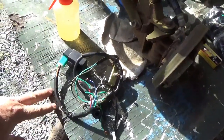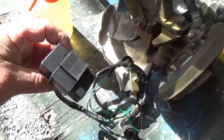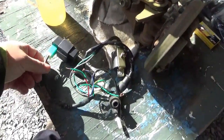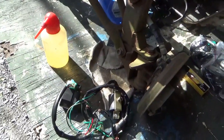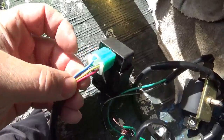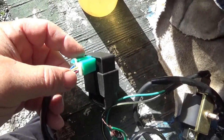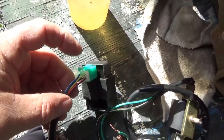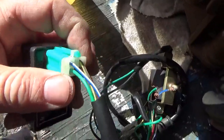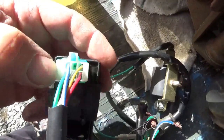So I brought this home and said, okay, maybe my ignition coil is dead — no, it was fine. Maybe my CDI is dead — no, it was fine. So I took the wires off, hooked it up, probing around and everything seems as it should be. What they did was when they manufactured it — you see the black wire with the yellow stripe and the red wire with the black stripe — they swapped these two on the harness. They were just plugged into the wrong places. So I'm showing you where they should be: that's the color code and that's the way they should be plugged into the CDI. If they're not plugged in like that, they're not going to start.